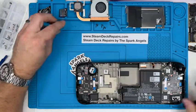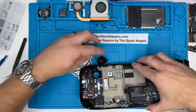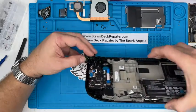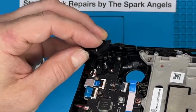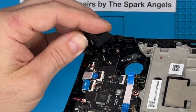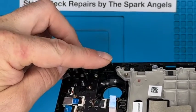I was going to show you, wasn't I? Yeah, so you see these 2 lugs there. Quite a simple design. You've got those 2 lugs, clip over it. So what you can do in disassembly and reassembly is do one at a time. You can put one on, put the spring in place. It's difficult to hold it in at the same time, and then you push that down in the other. And the same thing, you get underneath this one and you give it a bit of a pry out, and it pings off.